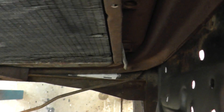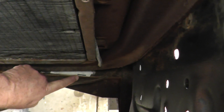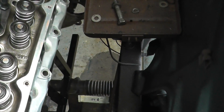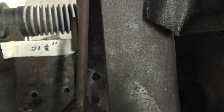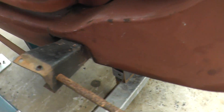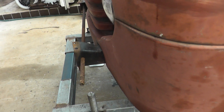This cross member down here has a 90 degree bend at the top - that's the reference point for the 21 and a half inches, measured towards the back to the rearmost part of the original Jag engine mount. It's pretty close, but the important thing is you want consistency on both sides. That's the reason I went with using the alignment bar and the measurement from that to the front mounting point - it's far more consistent.